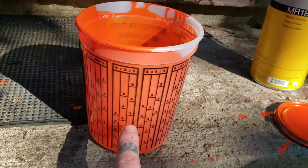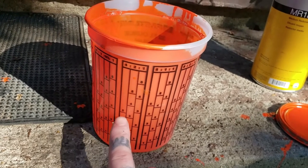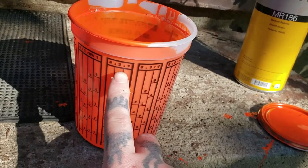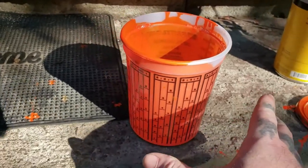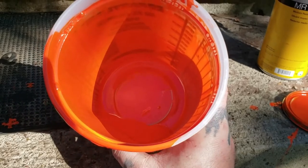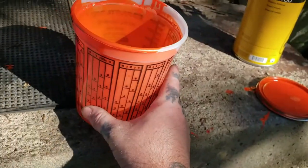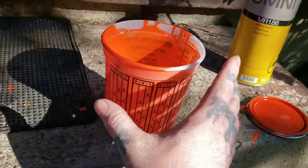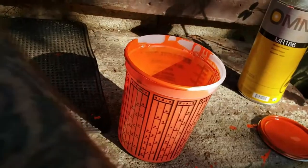On the mixing cup, instead of one to one you want to come to the side that says four to one. You can clean your cup out or use a new one. If you mixed up to the five on the Omni, you'll need to bring it up to the one on the four-to-one section — that's four-to-one parts. But for these engines we're just going to pour the leftover base back into the can and add the clear coat directly to this cup — it tints it and gives it a deeper shine. You can clean your cup out if you want to, but I'm not.